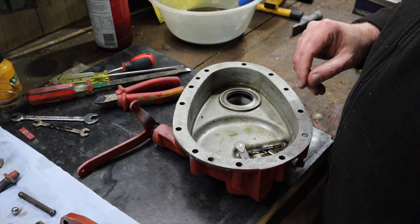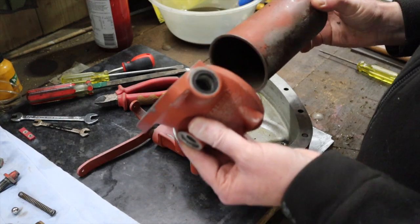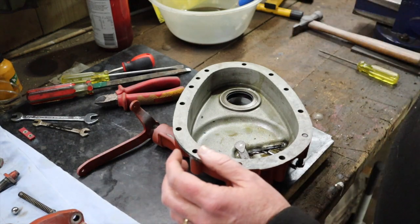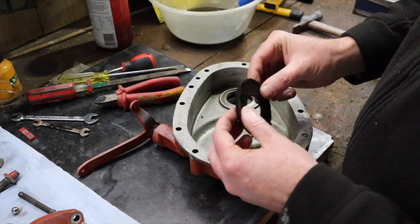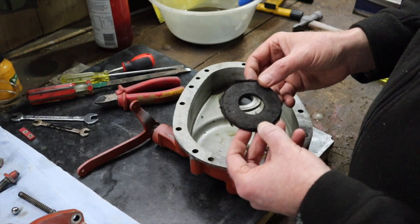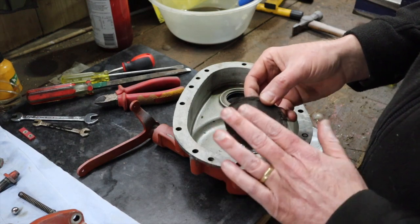So in the meantime, we'll have a go at the oil filter housing - the oil filter goes on here. This is the canister holder and obviously that goes in there. I've been soaking that in petrol for about two weeks and I think I've managed to get most of the dirt out. The interesting thing is that at the bottom of that there was a fiber washer which I didn't even know was there - it kind of came loose and came out. So I'm going to have to find something to make a replacement from. It feels like fiber, not leather - more like a fiber material.